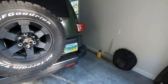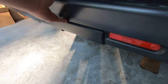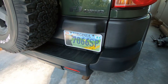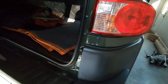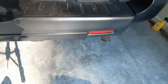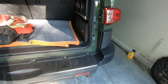After looking at this a little bit further, it looks like we're actually going to have to take off the entire rear bumper to do this job. The hitch goes right here, but the upper mounting bolts are actually under this part of the bumper and you're not going to be able to get to them without taking the bumper off. It looks like there are five bolts across the top, four up underneath across the bottom, and two more under these pieces here. We'll have to get the trim tool out and pop that out of the way.